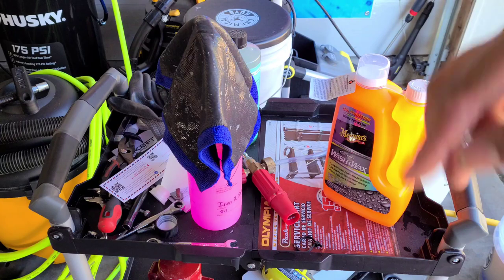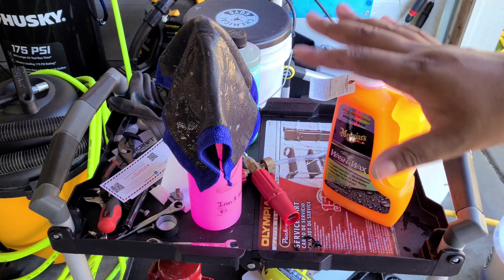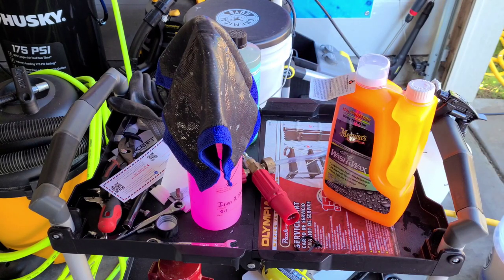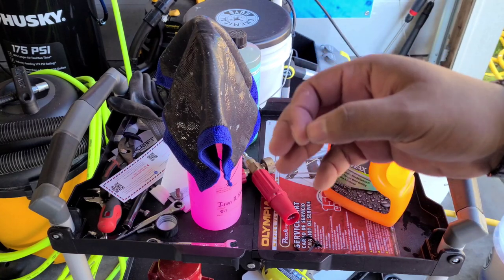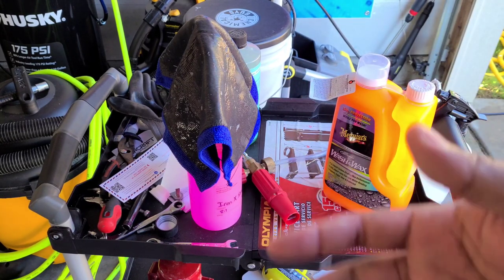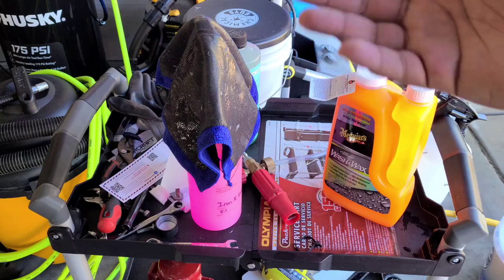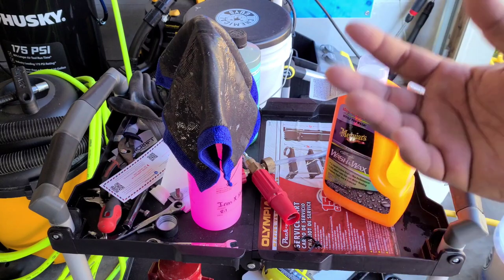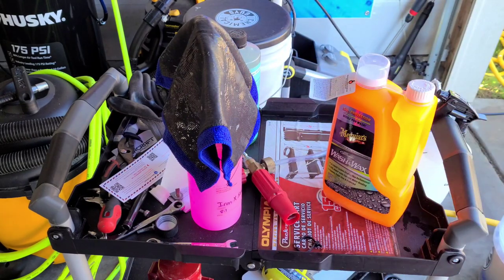The car's going to be sitting in my garage. If you're not familiar with decontaminating a car — if you ever feel your car's surface feels kind of gritty like sandpaper, you can also put your hand inside a plastic bag to really feel it. That's because there's a lot of dirt, iron particles, and contaminants stuck in your paint. Iron particles come from living near a railroad, industrial fallout, or — the biggest one — brakes. Your brake rotors are made of iron; brake dust gets all over the road, especially in the rain, and sticks into your paint. You want to do that at least once a year.